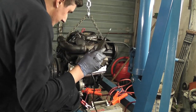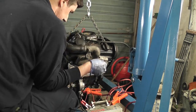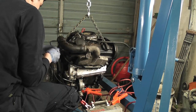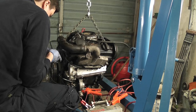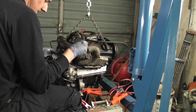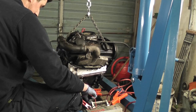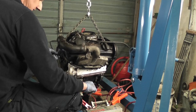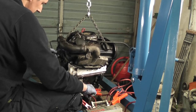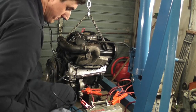So I could actually use it for putting power onto the solenoid for the start motor instead of the wire I have here. I'm not going to though. Green, because I'm getting the green light on that means it's negative, so that's grounded. So what we'll do is, when we crank over this engine, that should stop beeping when we crank it for a bit. It did. Although it happened instantaneously, so I'm wondering is the starter robbing power from the probe.